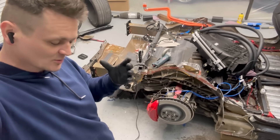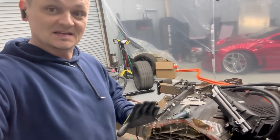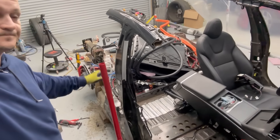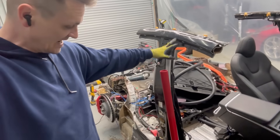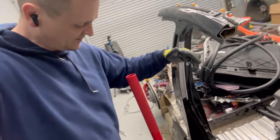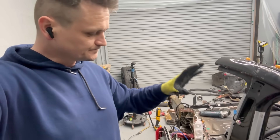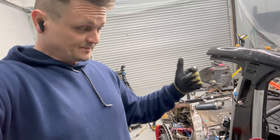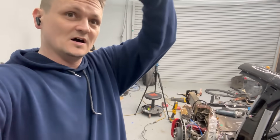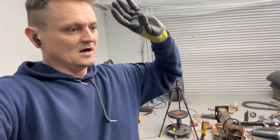I think I might have downgraded the crash test rating on this Model S just a little bit. The next step is the B-pillars. The front of this is aluminum and the majority is layered two times, but in the back it's actually metal. So the B-pillar is about 70% metal and then aluminum. Above the windshield where the driver's head is — that's metal. That's the only metal I found in this car, which is weird.